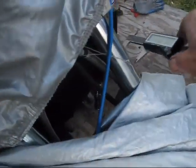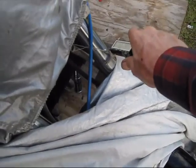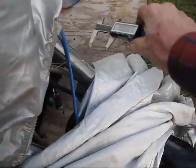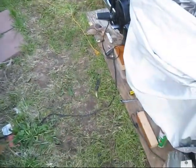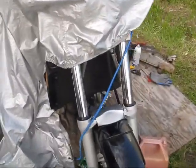The new forks are 1.7 inches and these original forks here are 1.575 inches. So that's — 40 millimeters for the originals versus 43 millimeters for the new ones. It's quite a bit bigger fork tube — should make it a lot stiffer. Let's pull them out here and get a comparison.